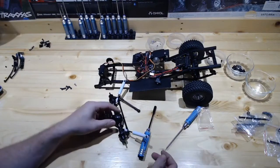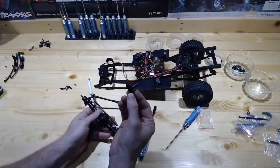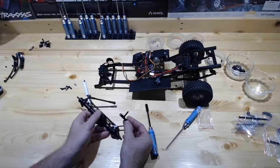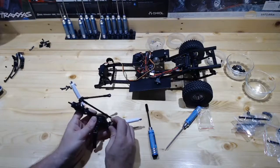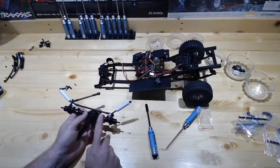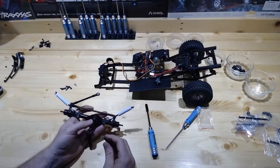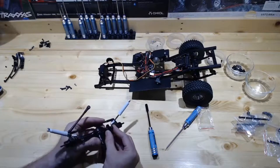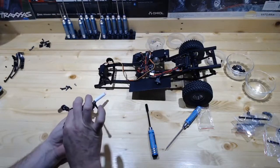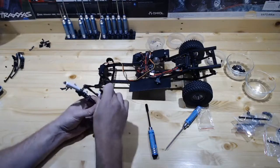This would be the Panhard mount. It's got a nice big radius on the inside. I just ground these down with a Dremel, went across once or twice, and then came back with a nail file. This is aluminum, so it's pretty easy to work with. What I usually do is take a little bit off and then try and mount it, look from the side, see if I see any daylight. If I don't see any daylight, then I feel like I'm good to go.